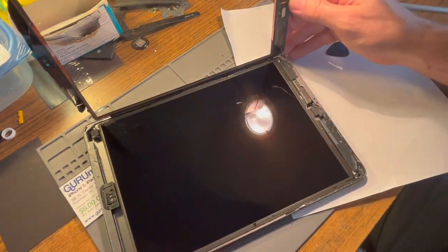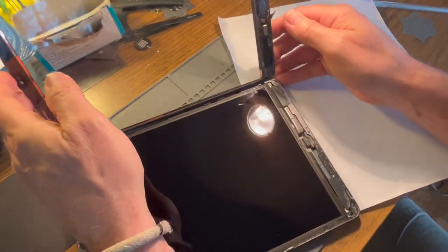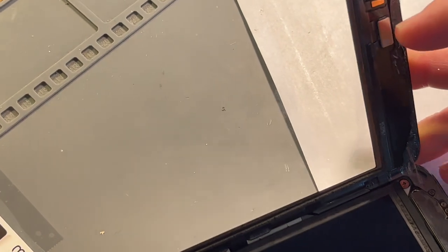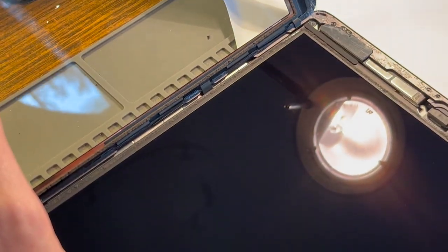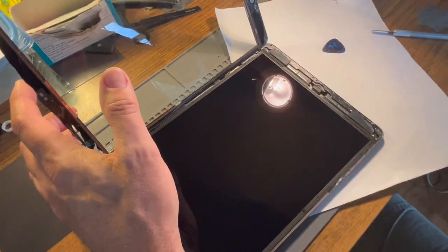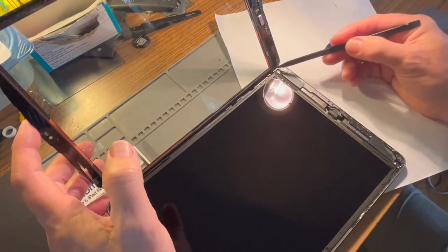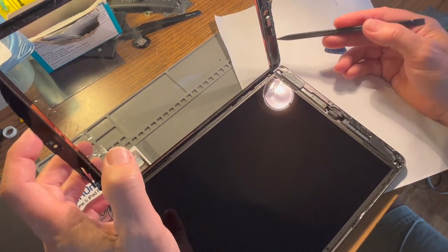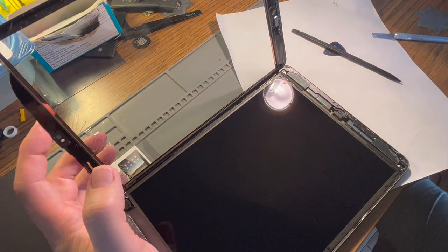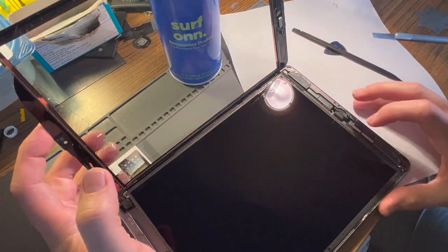If you look right here, you can see the cable running from the home button. Here's the little chip I showed you before. The cable runs right here, and right here is where the cable folds under the screen. This is what we want to be careful of. If you tear, cut, or stretch this cable too much — I won't even lower this screen any further than I have it right now because that's going to pull on this cable. So I generally take my compressed air can and just use that to prop up the screen at this point.